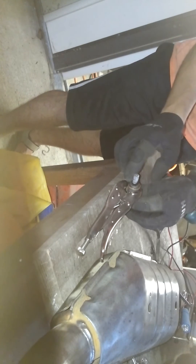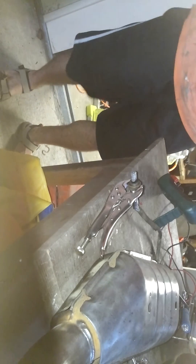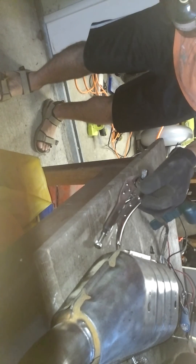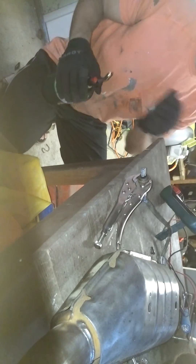This is how you do it. I got this kind of hooked up here. I got my voltmeter set to 2 DC volts. I got my safety glasses on. And then I'm going to heat this baby up to see if my O2 sensor works.